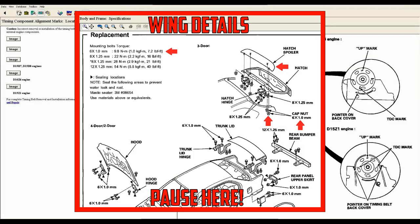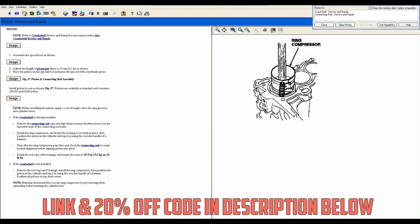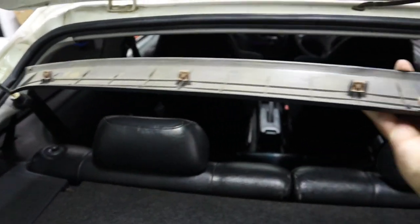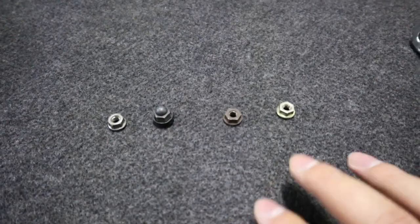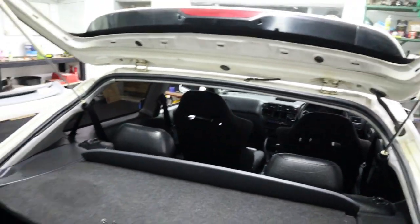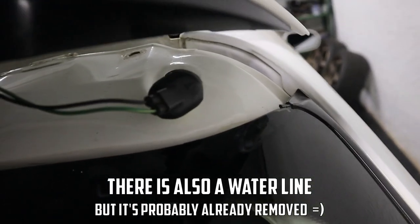Here's some technical information — I got this from a manual you can buy online for about $25; there's a link and discount code in the description. Whether you're trying to remove a door panel or rebuild the engine, it'll come in handy. To take your stock wing off: pull off the plastic trim piece, check where the tabs are and pull near them so they come off without a problem. Then you have two 10mm nuts — one here, one there — and the same on the other side. All you need is a 10mm socket to take the wing off. Once you have all that out, close the hatch and the wing should just lift off. There's a wire for the brake light — pull the rubber grommet out and unplug it.